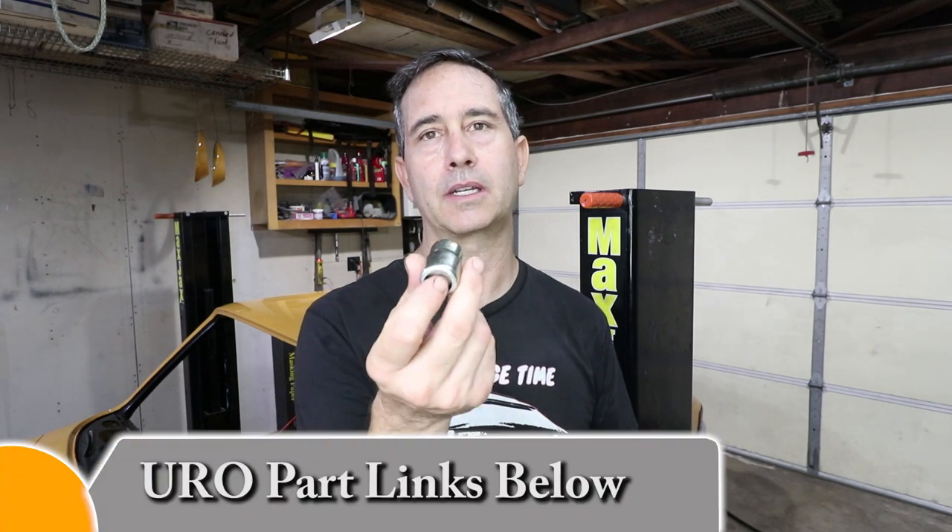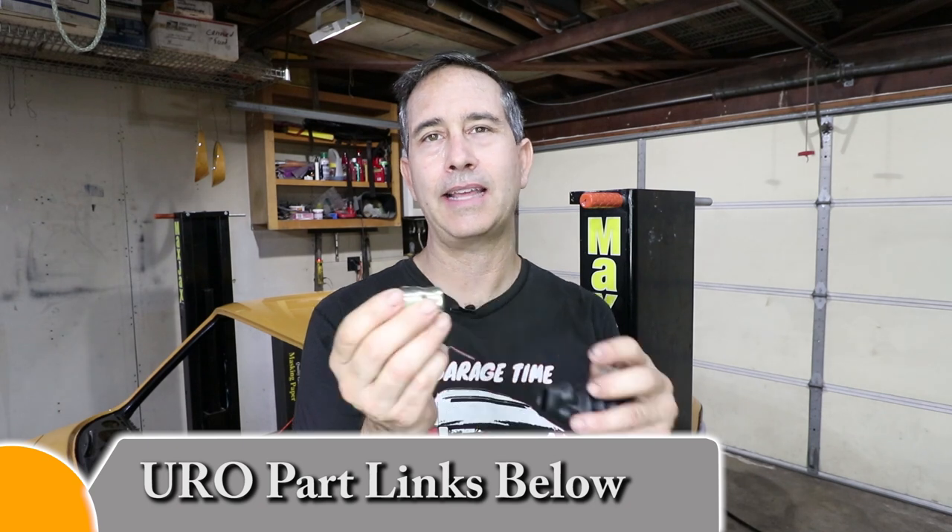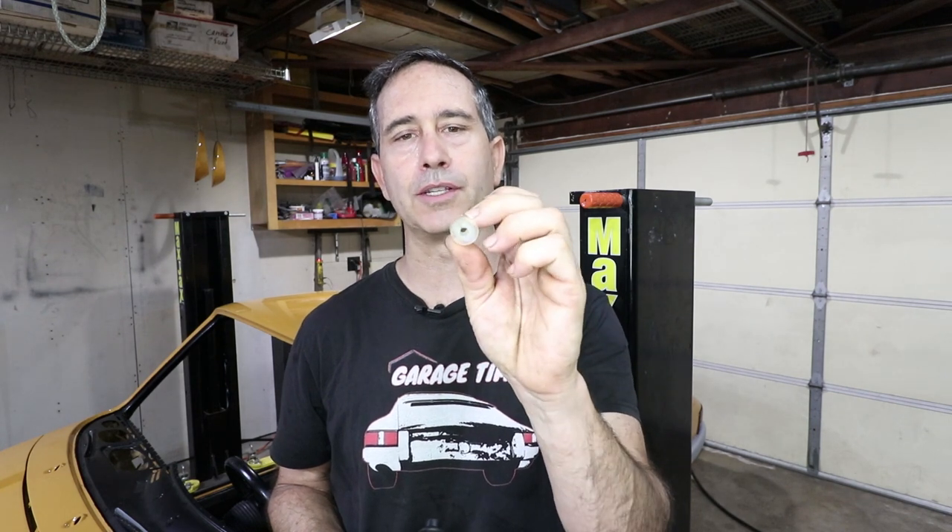I did get a few new parts. This is the coupler assembly — it's a rubber isolated thing that I think takes a little bit of vibration out of the gas pedal. This is the rubber boot that seals the accelerator rod inside the tunnel. And then inside the tunnel there are these bushings. There are three of these that actually guide the accelerator rod in the tunnel. There is no sheathing on the accelerator rod — it's just a simple piece of metal, but it does slide within these bushings, which get clamped in the tunnel.